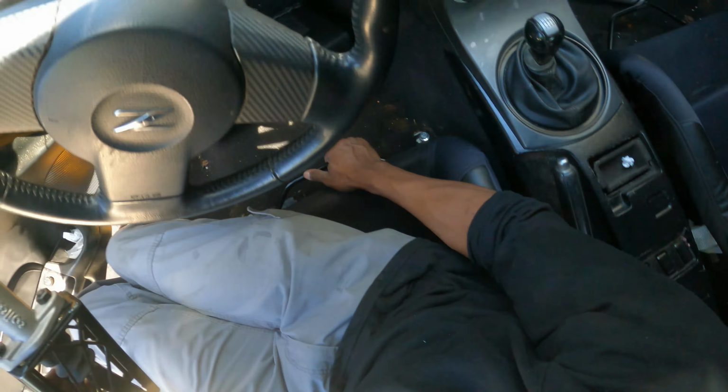You're not looking to shove it all the way through the hole, because it would never go through. Looking to get it nice and seated here. What I like to do sometimes is tap it down. If you're on a table, you can squeeze it down. But you basically just want to get it as far down until it stops, to the point where you can see the PTFE fitting through. Doesn't look too bad here. I would say try and twist it, but these frays are very, very sharp.